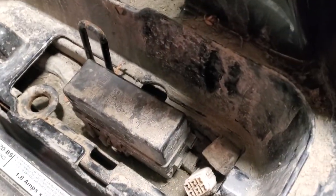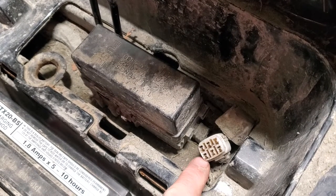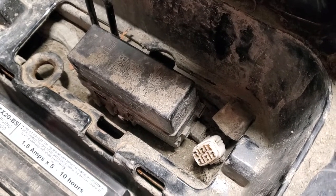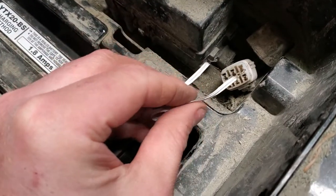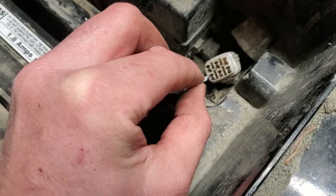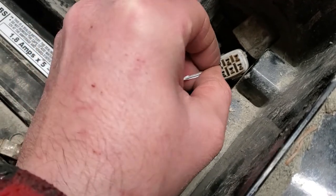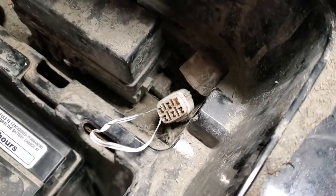What you want to do is look under the seat. Right beside the fuse block there's going to be a plug, and on one side of the plug there's going to be just the one wire — one conductor — and on the other side there are two. What you want to do is take a small jumper wire and short out those two connectors on the one side of the plug.